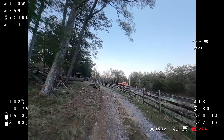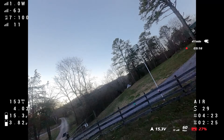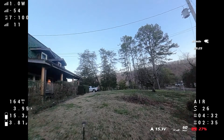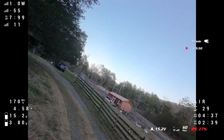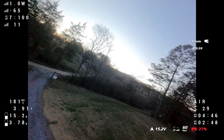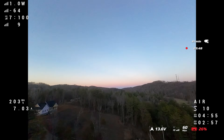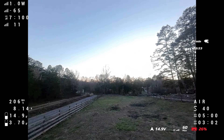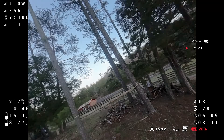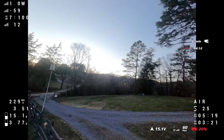People often ask: when should I land based on battery voltage? Look in the lower left — my average cell voltage is about 3.8 volts right now. With a lithium polymer battery, we can fly down to about 3.4–3.5 volts. The absolute minimum is 3.0 volts. Going below 3.0 volts will literally damage the battery — just like you don't want to run your car completely out of gas. Keep in mind that as you're flying, the harder you work the battery, the lower the voltage will be. If I go full throttle, it'll immediately sag down to like 3.2, but as long as we stay above 3.0, that's okay because once you're off the throttle, it'll bounce back up. If you're flying smoothly and see 3.4–3.5 volts, you should already be landing because it's going to drop quickly, and if you have a long way to go to get home, you're going to be in trouble.